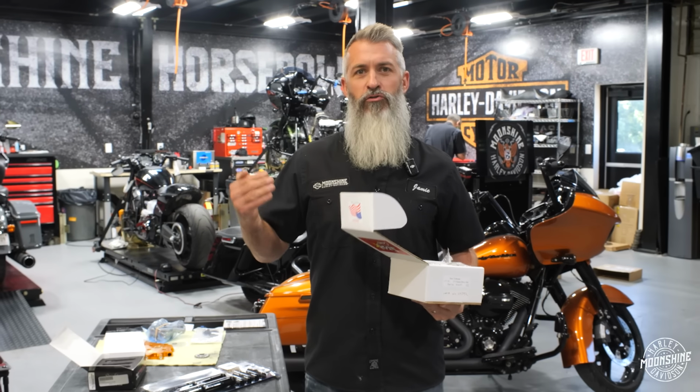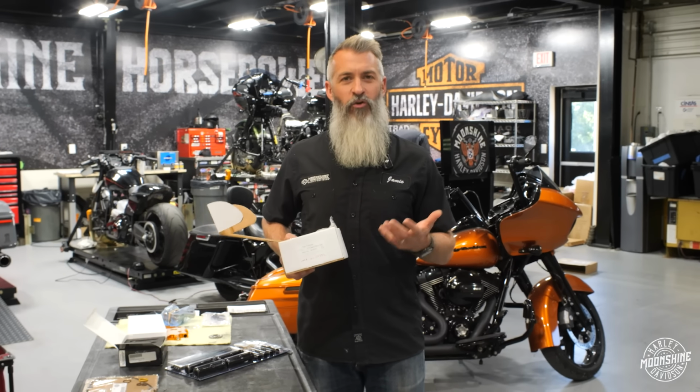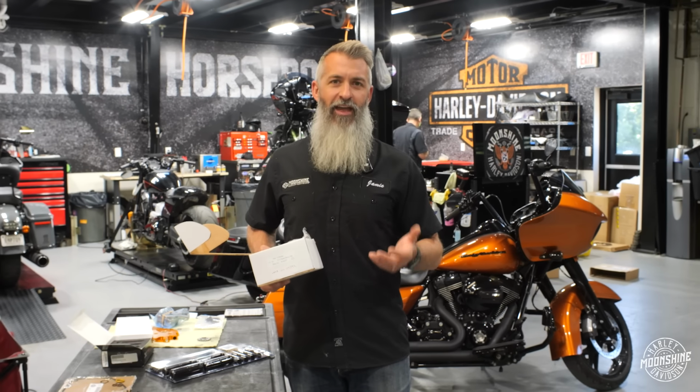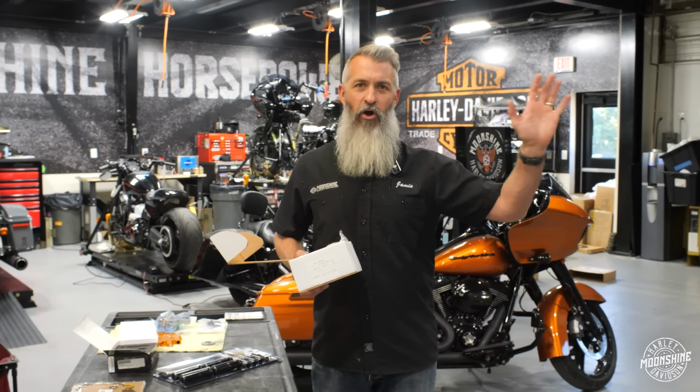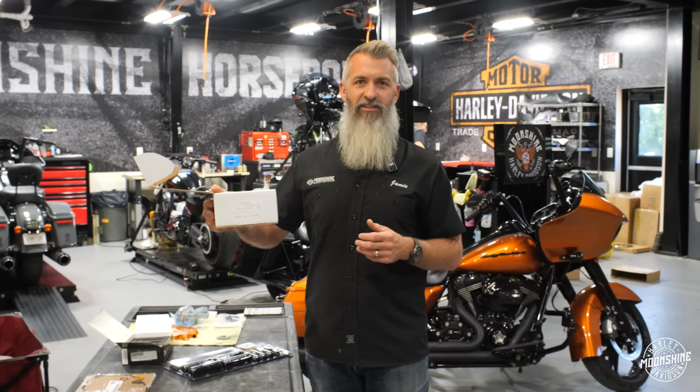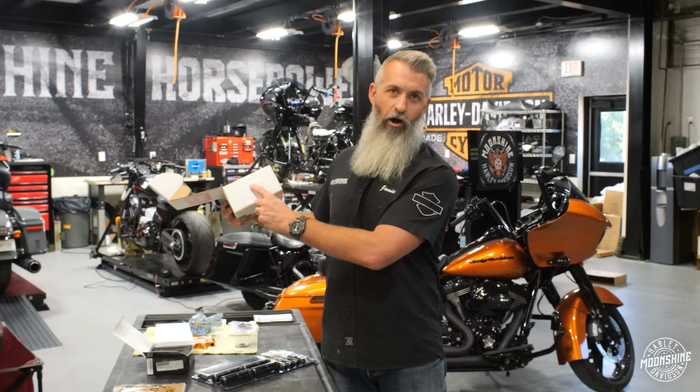We typically do a lot of Woods cams. We do a 222, which is your bottom end torque to mid-range cam. And then Wood has a 555 that is your mid-range and pulls a little higher up the RPMs. This guy kind of is in the middle of both of those, where it's your torque and mid-range cam and does everything very, very well. So Star Racing 577 Torque Star.